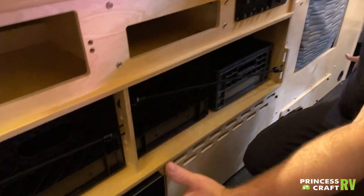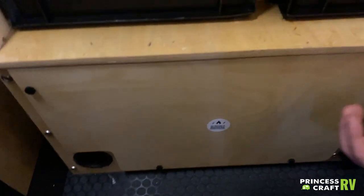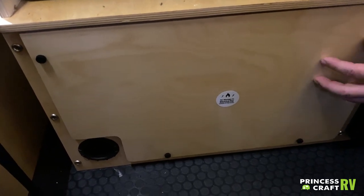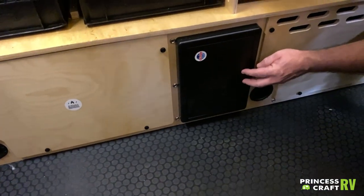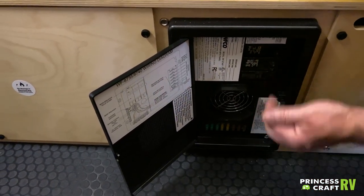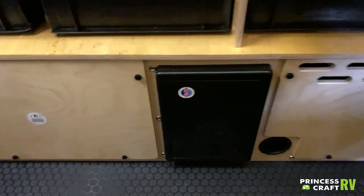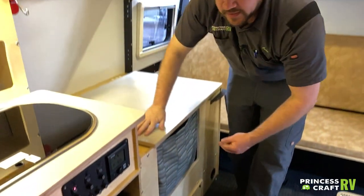To finish out the galley side, along the bottom we've got your battery compartment — there is a single battery in there right now but there's room for two. You can add another battery or upgrade to an AGM or lithium type to extend your camping stays without needing access to 110-volt power. Next to that is your WFCO power converter and power distribution panel, which has all your 110-volt breakers and 12-volt fuses — the 12-volt fuses are just like automotive car fuses, and the 110-volt breakers operate just like house breakers. This compartment is access to the Truma system for servicing, and this one provides access to plumbing under the shower that may need to be serviced.